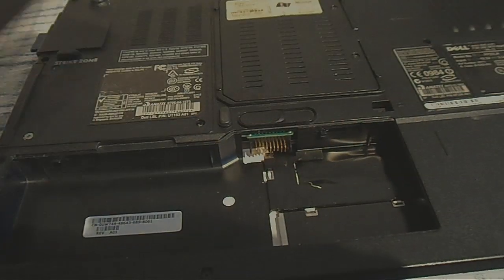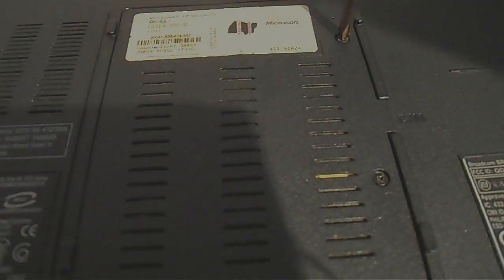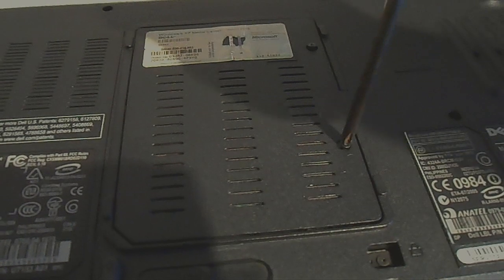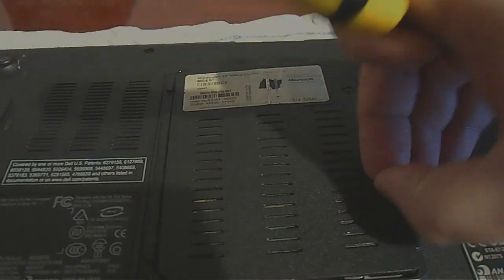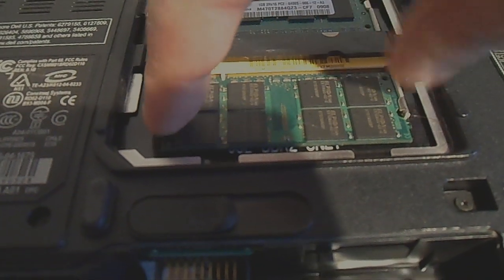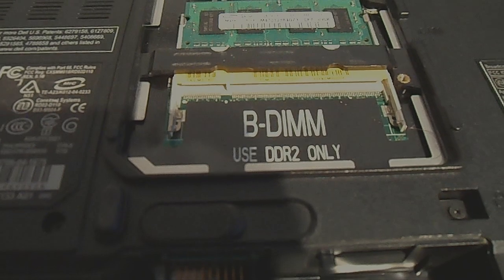The first thing I'm going to do is take the battery out and then start unscrewing the lid to the memory. That's the memory cover off — there's 1.5 gig of RAM in there at the moment. There are two retention levers, one on each side — make sure you push those two out and the memory will lift up. Put that somewhere safe.